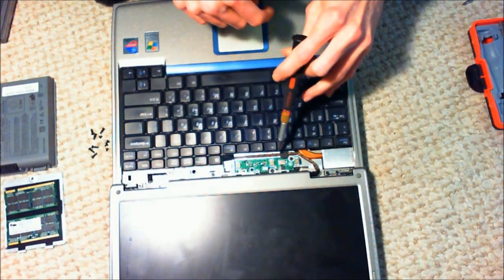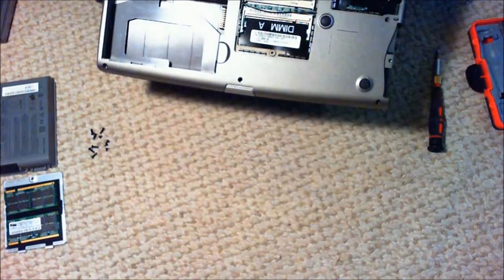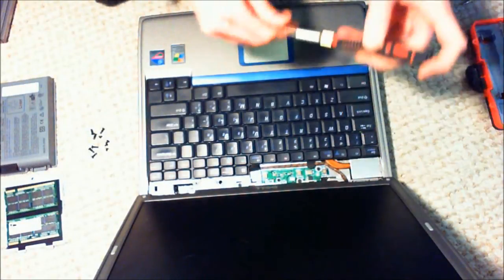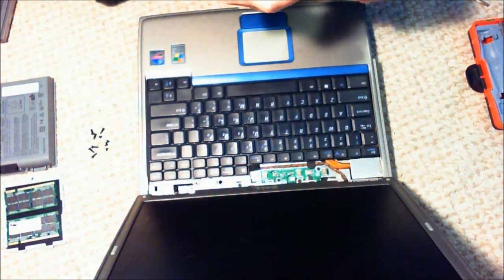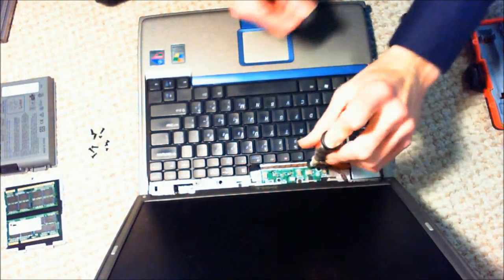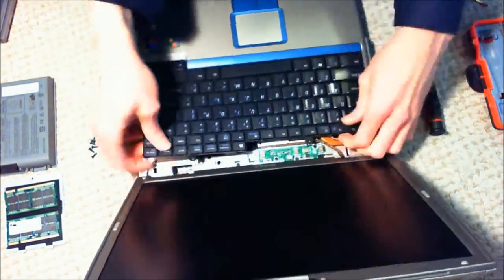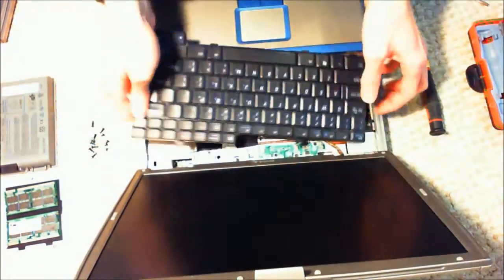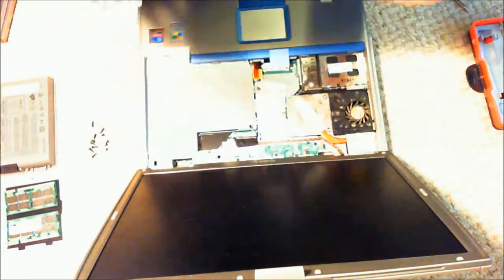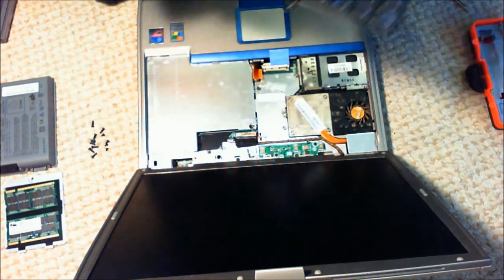Underneath here you can see this cord that goes up to the monitor — parts of it come from over there — and that's the cord you need to be able to get out in order to remove the monitor. So before you're able to do that, you have to remove the keyboard. In this case it looks like there are two screws mounting the keyboard. Keyboard out. As I said, this thing's kind of janked out — it did have Coke spilled directly on it, so I'm not going to be using that.